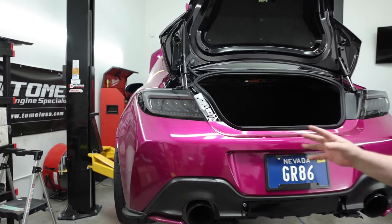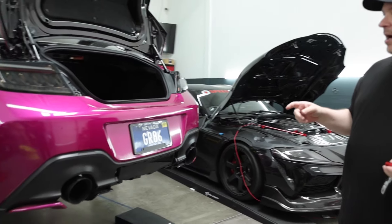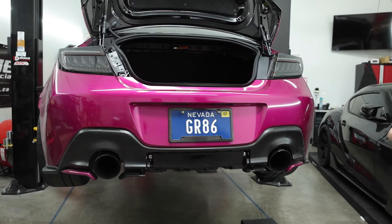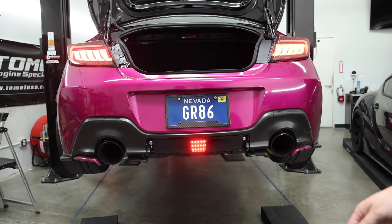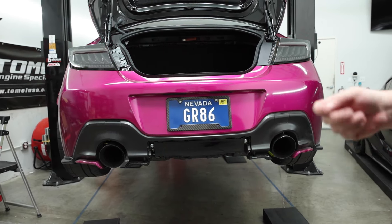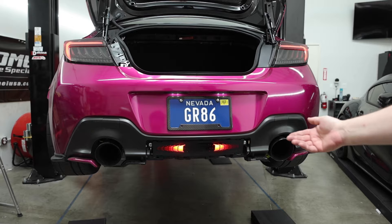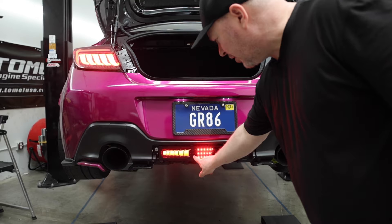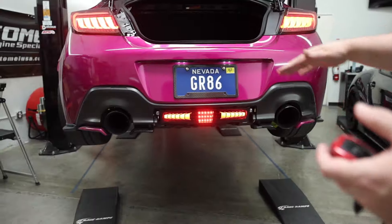Before you button everything up, this is why I left the taillight off — it's a good time to check everything. I'm going to test what that red wire does on the inside. I got Caleb inside the car — we're going to hit the brake lights and show you that the F1 function is actually working. So you can see the F1 function — if you hold the brake lights down, it just kind of stays pretty solid there. Let's take the brakes off and put our parking lights on. So you can see this actually has a little animated sequence, which is super cool. Obviously we can't really put it in reverse because the car's not running, but the reverse was the OEM plug, so if you do reverse, these two will actually light up. We'll show you that on the ground once we get this all wrapped up.